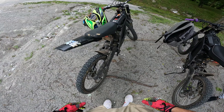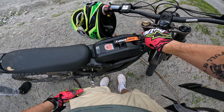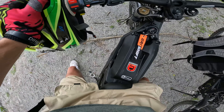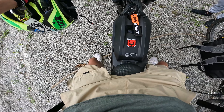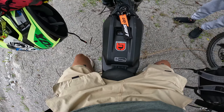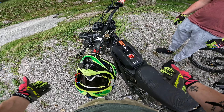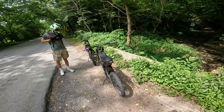The number one biggest problem I have with this thing is that sometimes — most of the time — when I turn my bike off and back on, it won't engage. I just turned it off and back on, the kickstand is up, everything should be in order, but giving it throttle the bike will not engage. If this happens to you and your bike doesn't start up immediately, don't freak out — just turn the breaker off and on a couple times and you'll be good to go.